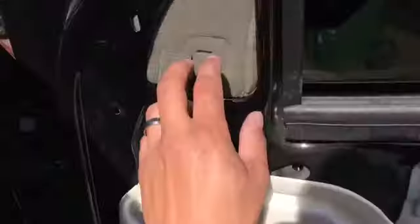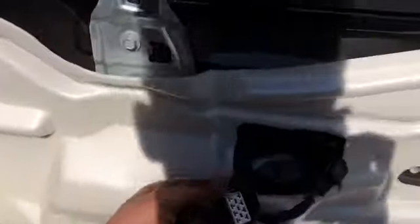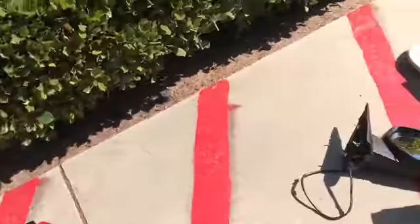See how this one has that trim look. What I had to do was — it has three 10 millimeter screws right here. Pop this out, pop these out, and the key goes through this motor. Mount it on, connect it back. Before you assemble it, make sure you turn on the truck and roll the mirror down. Once you put everything back together, make sure the mirror motor moves left, right, up — before you assemble all this, because something could be wrong. You don't want to put the door panel back and then have to come back and change it out. Here's the door panel off.